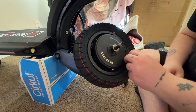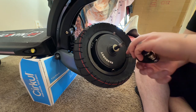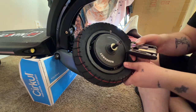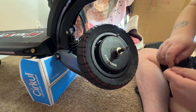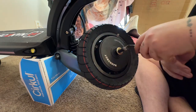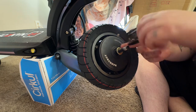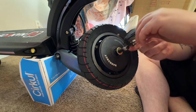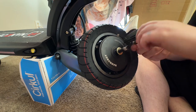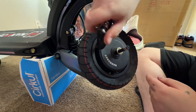Psych, I'm going to drop it. Put another one in. Make sure the hub motor don't fall on me. So again, I didn't tighten that guy up. I'm putting two more in. I'm not going to tighten these up too tight. Just get them down to firm. Or not even firm, just a little snug, like finger tight. Just once I start feeling resistance, I give up. So down, down, down. Resistance and stuff. And I'm going to do that for the rest of these.